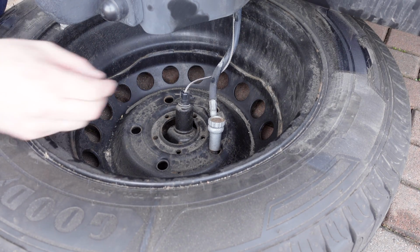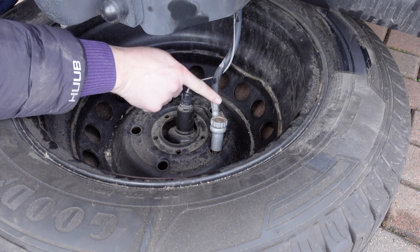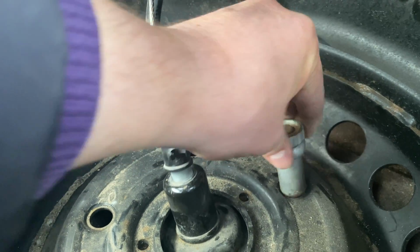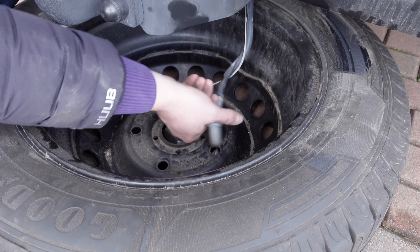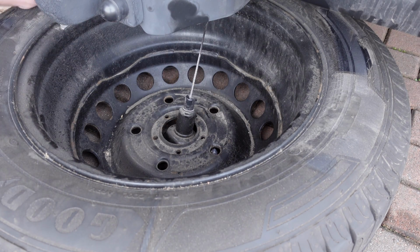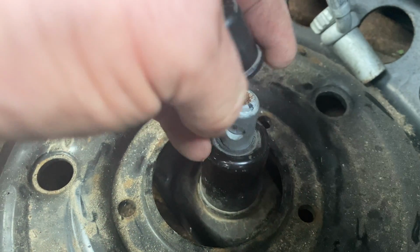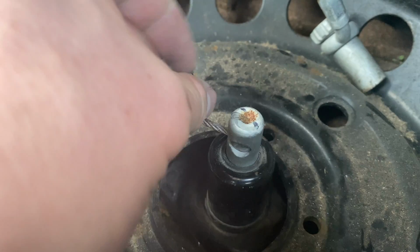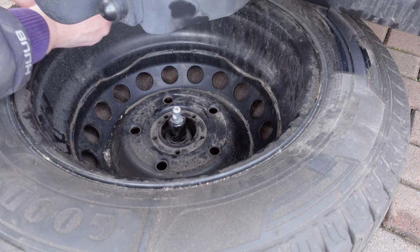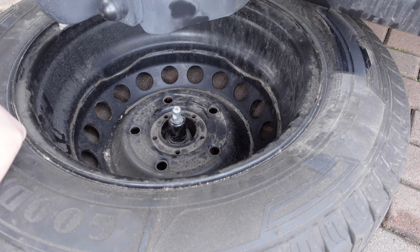Okay, so I brought you in tightly for this shot, and as you can see, the nut on the end of this safety cable is just hand tightened. So you just undo that until it loosens, and then that can move out of your way. Now to release this cable, you simply lift off the cover, you turn 90 degrees and pull forward. Now the tyre is free from its storage and we can lift it away.